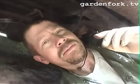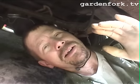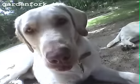Okay, so we finally got the four bolts out, so this is gonna be easy now. We put the bushings into the spring. We connect the shackle bracket to the spring, and we have to jack the frame up a little bit just to drop it right in the right spot. We put the bolts through under the frame, and we're done. Right, guys?